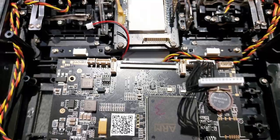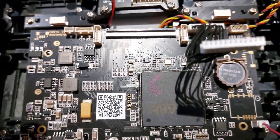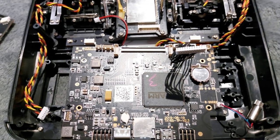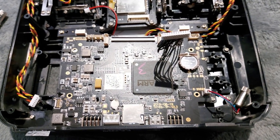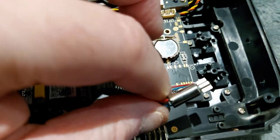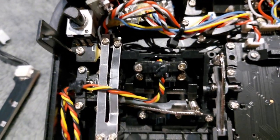I've taken out the roller and the switches, and I've also undone this board. The motherboard connects on here with a ribbon connector — the only one in there, the white one with a blue end. The reason I'm taking this out is that underneath there's another ribbon connector going to the screen. I'm not sure how that will come out yet, so I'm going to take out the part above it first. You'll also have to take this little vibration motor out — it simply spins around and creates the vibration feedback.